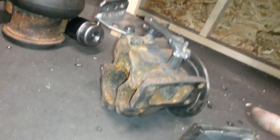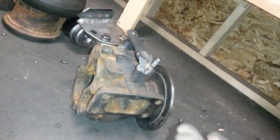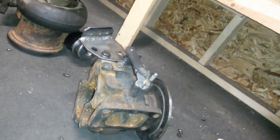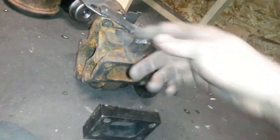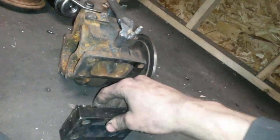So we decided to run an undivided 1-inch spacer. What that allows is that when this is open, there's cross flow. The reason for running a divided housing is for a faster responding low end. Well, our low end is going to be done with the quick spool valve. So the moment this opens, you really want as much cross flow as possible, which a 1-inch undivided spacer should do pretty well at doing.